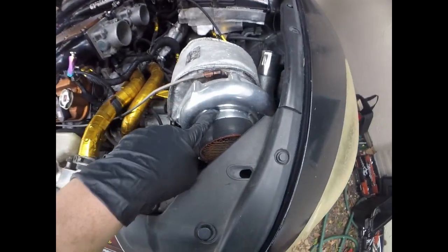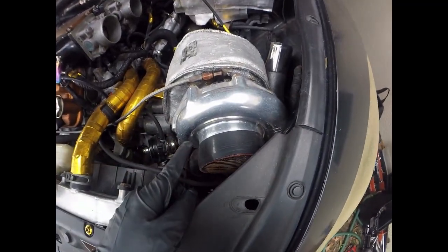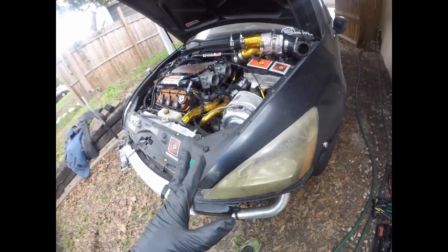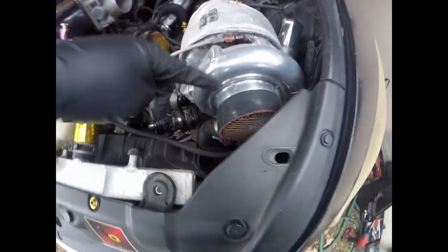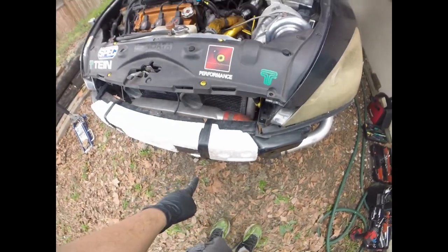So it came off of the turbo. How did I go? I think I came off the turbo and it was routed so this outlet was going back through there, then it routed all the way back through here, connected here, then routed all the way back around like this. So basically the two tubes were going back all the way through here. So what I did to cut it off, I just clocked the turbo down like this, and it goes straight down right into the intercooler.